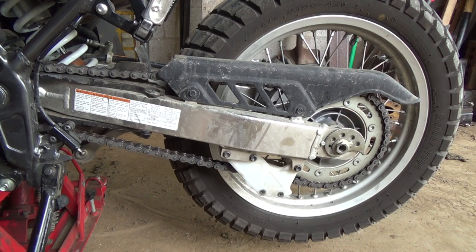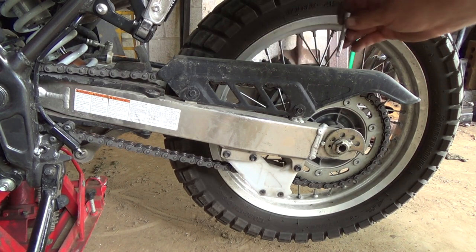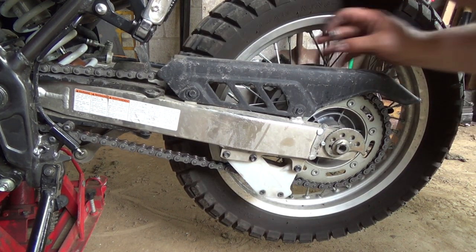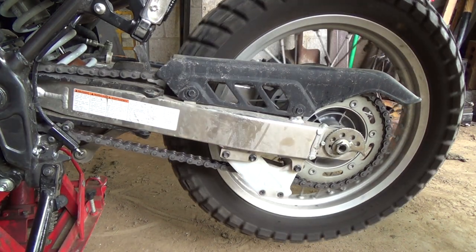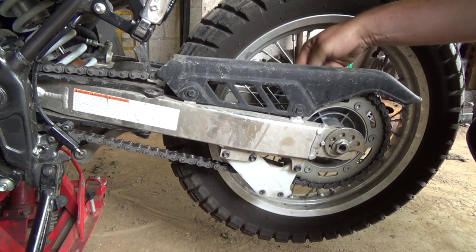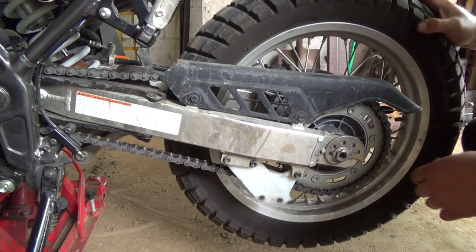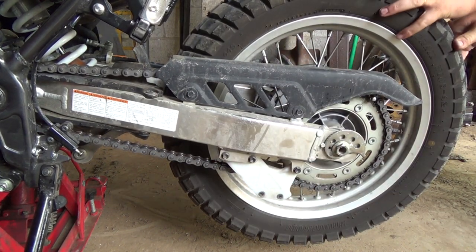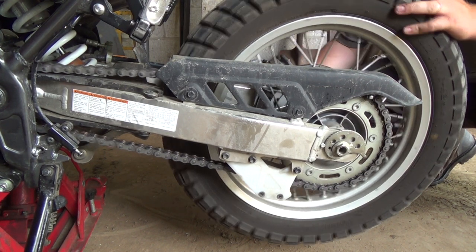You gotta sort of do, and it might work and it might not work for chain tightness, is you put something that's going to fit between the grooves of the sprocket, and you roll. If it was out of gear, it would work better. Okay. Yeah. You jam that in there, and then what this does is pulls everything here all tight. Whoa. Kind of like that. So the chain is super tight now, but that tightens everything up against the adjusters here. So now we go ahead and, whoa.